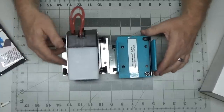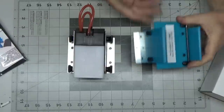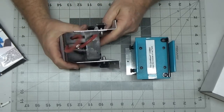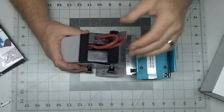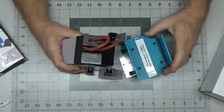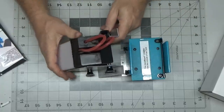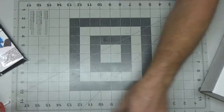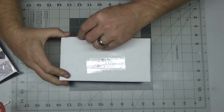In terms of tanks: this new one does not come with a tank and is made of some plastic-type material, while the other one is all metal and comes with a large tank I've actually grown to like. What's really cool about that tank is it has ports so when you're not using it, you can just plug your fuel lines in to keep garbage out. Every other time I have to use a piece of brass tubing to connect my tubes together to keep air and debris out.